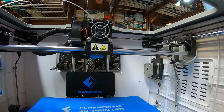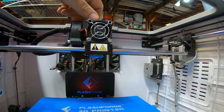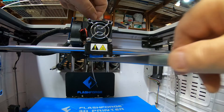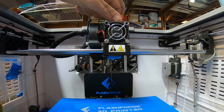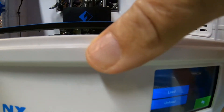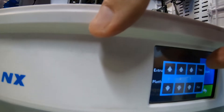When I get most of it out I just push the unload button — it'll stop by itself. There's a tiny bit left so we'll try one more time. Since I'm doing a prototype it doesn't really matter if a tiny bit of PETG is in there, but we want to get it out as best we can. I did it about five more times and there's just a tiny bit left. Now we're going to transition to the lower temperature — set our extruder temperature and reset the bed temperature too.